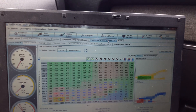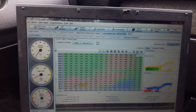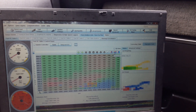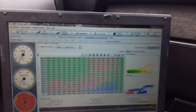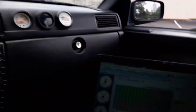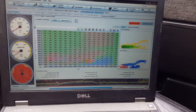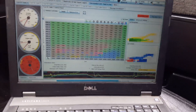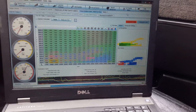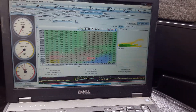We'll go to tune analyze and start auto-tune, then I'll go through the rev limit real slow. It goes through there and changes it — and of course I'm in a parking lot in a back alley, not trying to do this around people's houses, it's entirely too loud. I'll do that a couple times, then hit save on ECU because it can only change a certain percentage at a time. Then I'll hit stop, that'll reset this box, and once I start over again I can change another percentage.